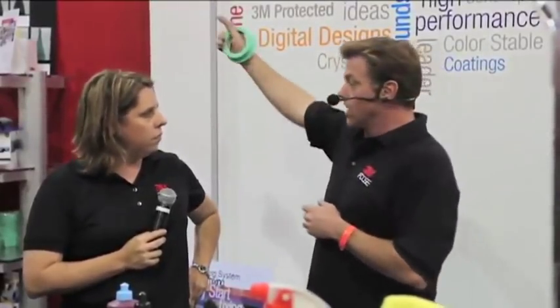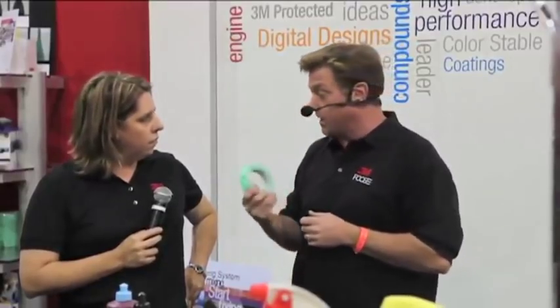If anybody has been up to the overhauling area where we're building a 2012 Chrysler 300S in the South Hall upstairs — we pulled that car out yesterday, at the end of the show, and took it over to Exotic Car Paintworks just across the freeway. We painted it last night using the tape to tape it off and sprayed the whole thing. The car was originally black — we saved the black on top, sprayed an orange stripe, masked that off with the Precision Masking tape, then sprayed a silver. I created four different colors of silver, doing the whole base and breaking three other colors down. The bottom of the car is about a number seven gray tone — really dark, a beautiful subtle blend in about 14 inches at the bottom of the car. We used the Precision Masking tape throughout.